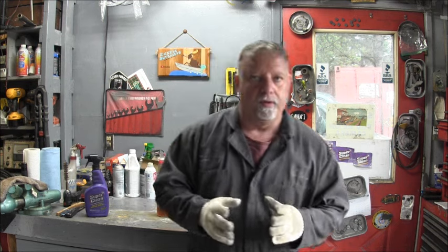The ignition systems, from my understanding, and this is what several other subscribers have weighed in on, have a little bit of a different ignition system on these older two-stroke Suzukis. I even have an adjustable spark checker I use. It's just the kind that you can dial in real close. And even then, a lot of times on these Suzukis, I'll have to cut off the lights, shut the door, in order to see that spark.